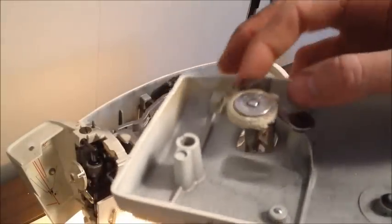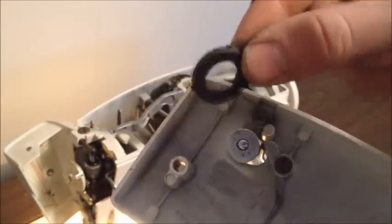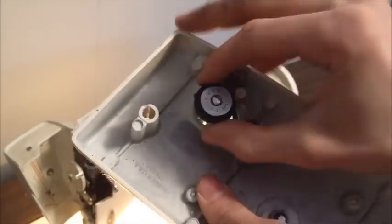Under the cover you can see this o-ring. This white ring is made out of a sort of rubber and is supposed to be turned by the drive shaft by friction. Here it's pretty worn out and dry so I need to change it — that's the fault piece. I used a hose washer which seemed to be fine for the friction and fit.